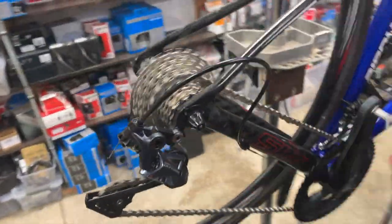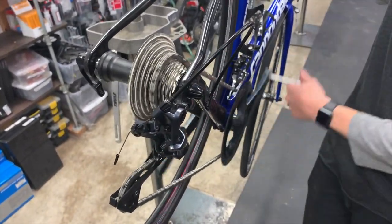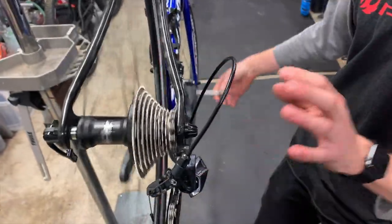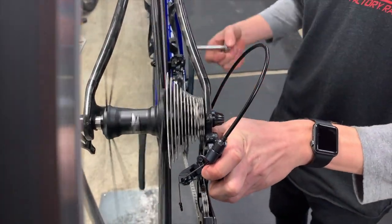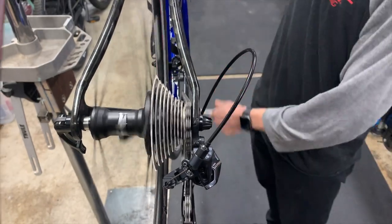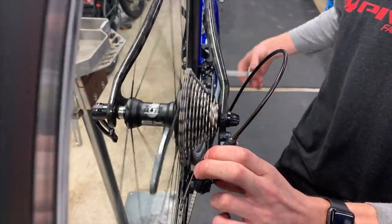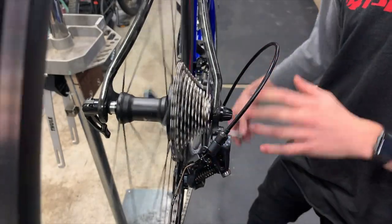So just to wrap up the rear derailleur — how to check if your derailleur is properly set up. You want to have your bike in a stand somewhere you can pedal it. Go through the gears looking for that quiet noise where all you can hear is the chain. You do want to check the high and low set screw. While pedaling slowly — and if this is set up wrong it can really damage the frame — I'm going to pull on the derailleur gently and I can see the chain isn't budging at all, not wanting to shift into the frame. I can also repeat the process up top. I'm going to slow the wheel down because if this is set up improperly it will go into the wheel. I can push on the derailleur towards the wheel and the chain is not moving, not going into the wheel. The derailleur doesn't have any additional play — that's a safe, well set up derailleur.